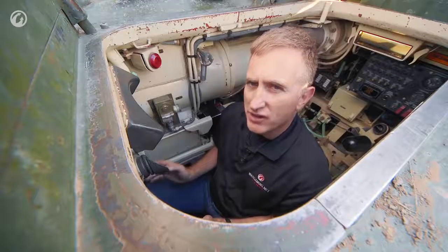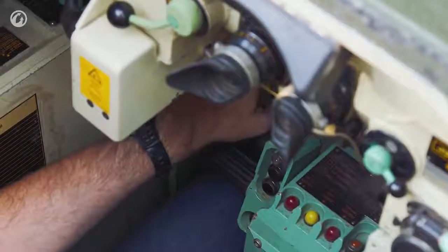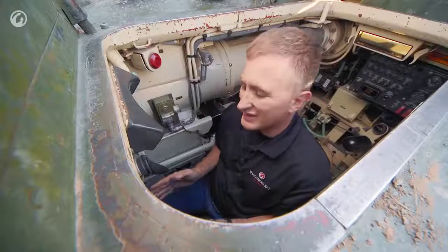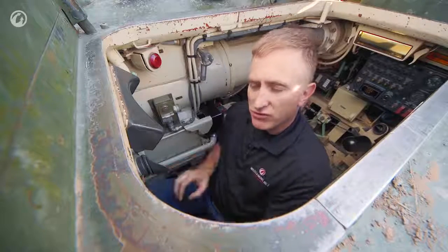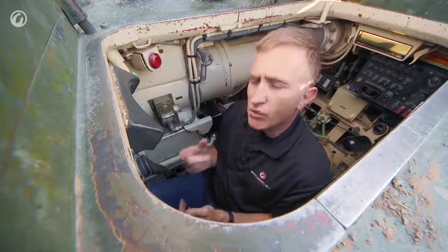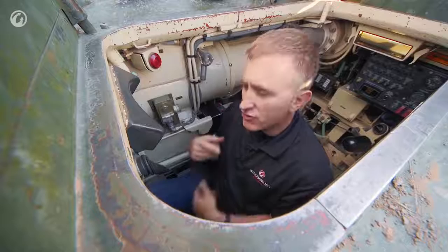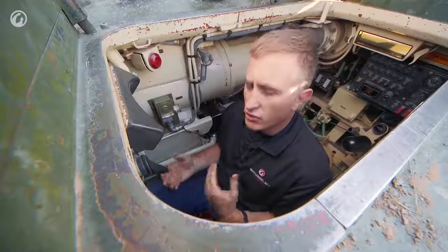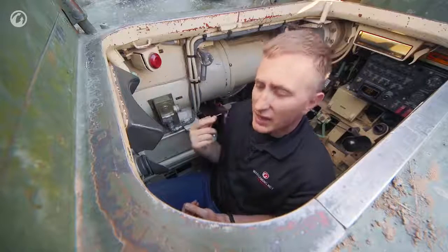In the event that this primary steering system fails, there are two alternate control handles — a far more traditional steering system with a clutch brake. And that is actually one of the techniques for getting this thing to turn quickly. If you're sitting still and you simply traverse the handles, the vehicle will take about 12 seconds to do a 180-degree rotation, which is not bad but not great. However, if you're driving along at a fair clip and then pull hard with the controls, you're going to do what's called the clutch brake steer.